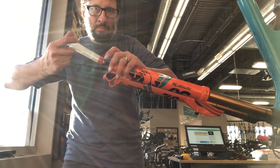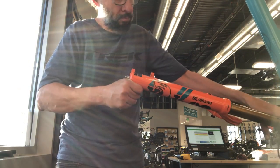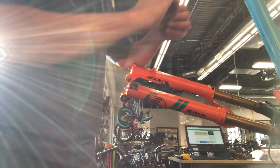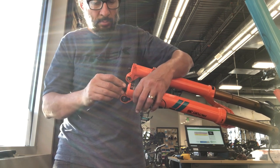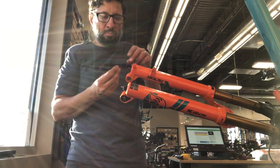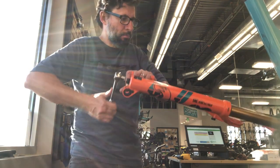Once you get those on, slide your lowers all the way back on. Once you get them on, you'll see the two shaft ends pop out. Put your crush washers back on, put your nuts on. Fox's torque spec calls for 50 inch pounds, which converts to about 5.65 newton meters. You want to be careful not to over-torque these because it is aluminum shaft parts and the nuts are aluminum as well — so definitely go easy on the torque. If you've got a torque wrench, that would be ideal.